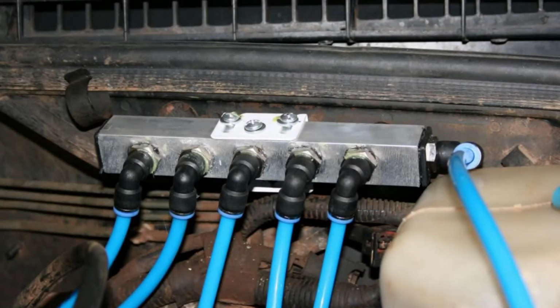The extreme guys even put those pipes up as high as the A-pillar in front of the windscreen. Other guys just fit them to the highest point inside the engine bay. A lot of guys also do the fitment so that the breathers go into the dash. What I don't like about that is, if you don't have decent filters at the end of those pipes, you may start getting the smell of ATF fluid and diff oil inside your car. So have a look out. My suggestion would be to fit it high in your engine bay.